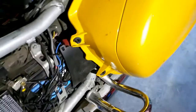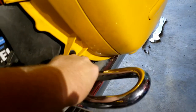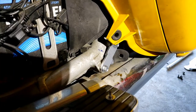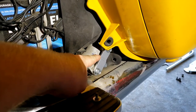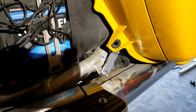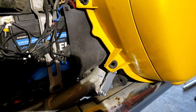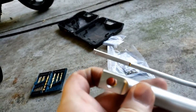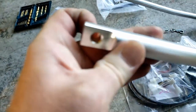The next step is to remove some bolts in here. I got these support brackets installed. On the other side you do a little drilling so the bolt can go all the way through and attaches to the hitch frame. You torque it down and then the hitch frame will just sit on top of it. On this side it screws into it; on the other side it just sits on the bolt.